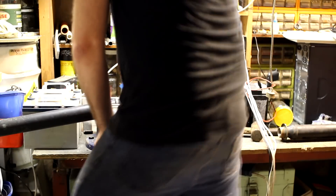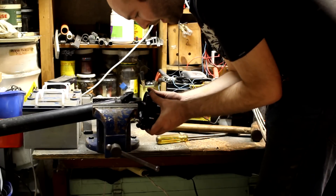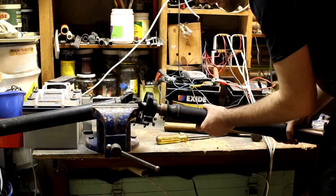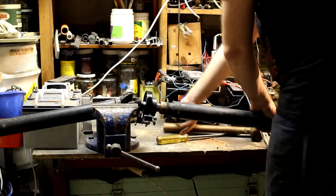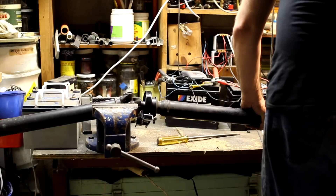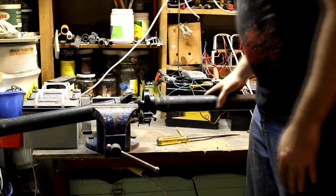I'm going to have to do that later anyway, so now's as good a time as any. That won't go on fully by hand — you can probably start it by hand but it's not going to go any further than that. I've got a perfectly good tail shaft to hit it on with. Same with this end — it's not going to go on by hand. I don't want to wreck the front of the tail shaft by hitting on it.